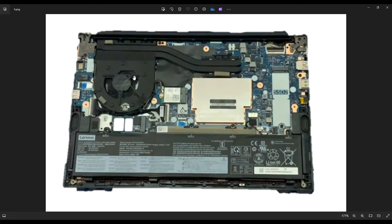After you get your computer open, this is what you're looking at for the inside. Just like we made sure your computer is powered off and unplugged, we're going to now unplug your battery. That's the first thing you do before messing with anything — take the battery out. It's this long thing down here, held in by five screws up top, and it unplugs from the motherboard right here in this port. Don't just pull on the wires — you can damage them that way. Grab the plug on either side with your fingernails or a small plastic pry tool and slowly jimmy that out until your battery is unplugged.